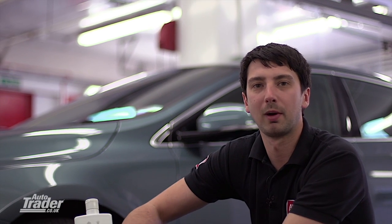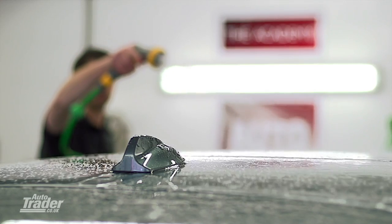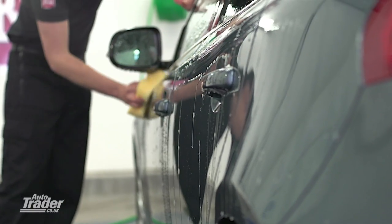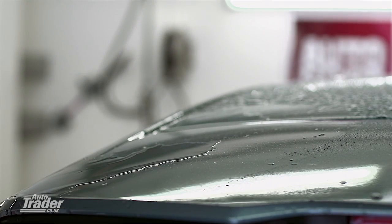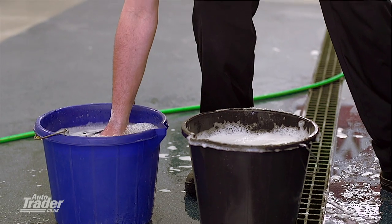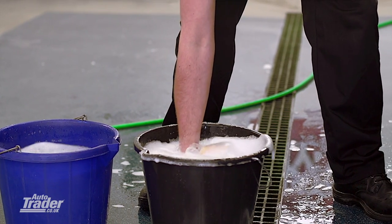So that's the wheels done. It's time to move on to the bodywork. It's important to use the right amount of product — two capfuls is all you need. If you put too much in, it's going to be difficult to rinse and can leave streaks. Now we're going to rinse the car off. It's important you make sure the car is out of direct sunlight when you do this, because otherwise it's going to dry too quickly and leave watermarks. Rinse the car top down to remove the loose dirt, because you don't want to be shampooing the dirt back into the paintwork. When sponging the car, go in straight lines the way the light goes over the car, working top down. You don't want to go in circles because that's what puts swirls into the paintwork. When rinsing off, rinse the sponge in the clean bucket of water, that way you're not transferring any loose dirt back into the shampoo bucket.